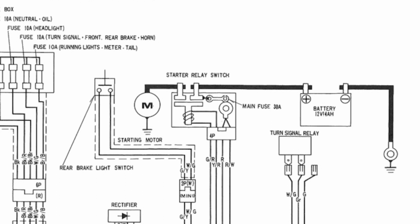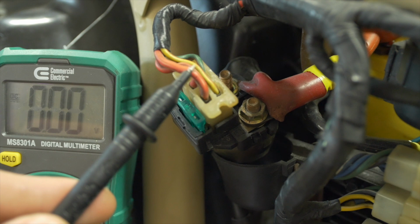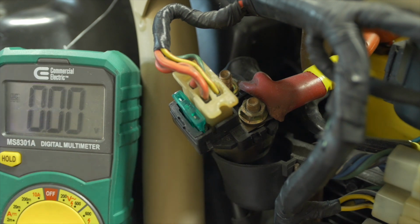So if you were to hook up the wrong type of battery, maybe anything other than a 12 volt DC, this fuse would probably blow to protect the rest of the bike, which is accessed through the red wire. And likewise, if the regulator had failed and it was not converting the AC electricity correctly, that would be traveling through this red and white wire, and it would probably cause the fuse to blow, which would protect the battery, as well as the other components of the bike.